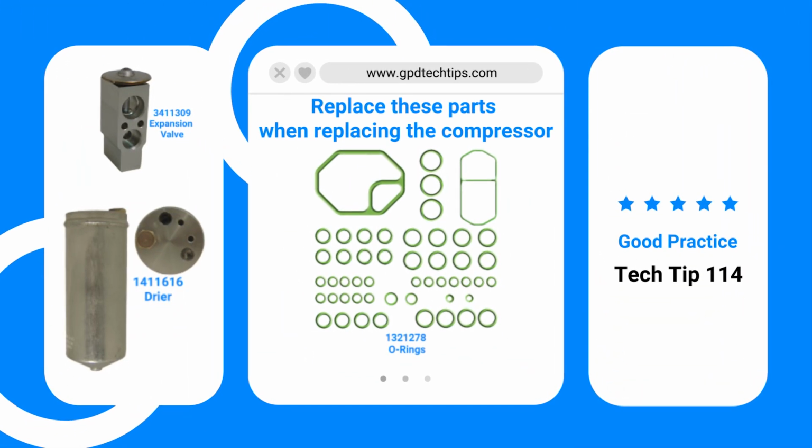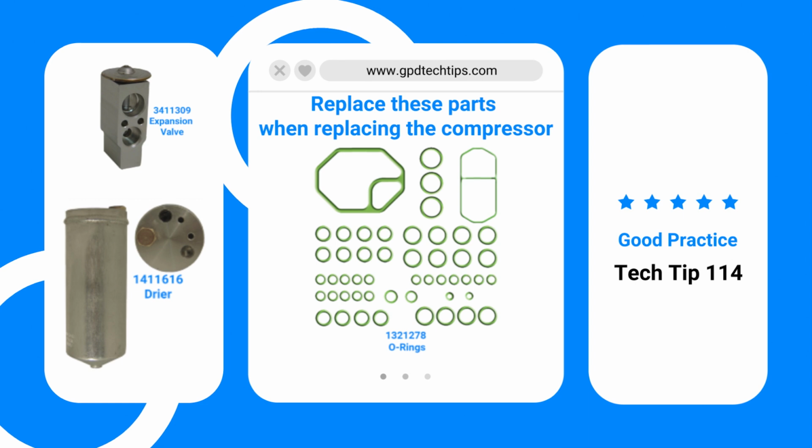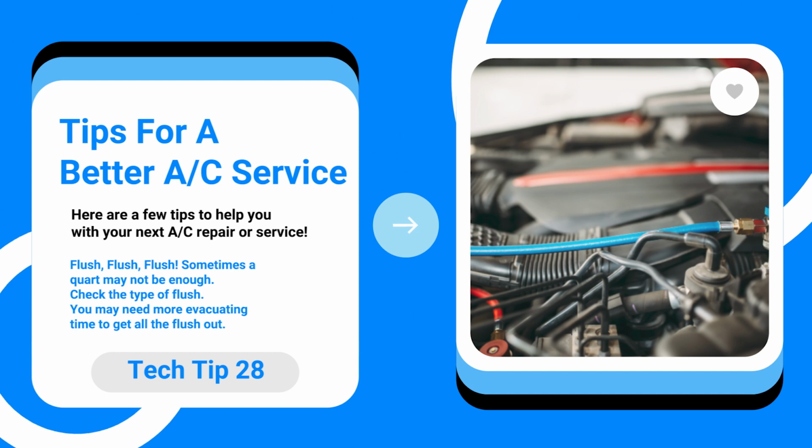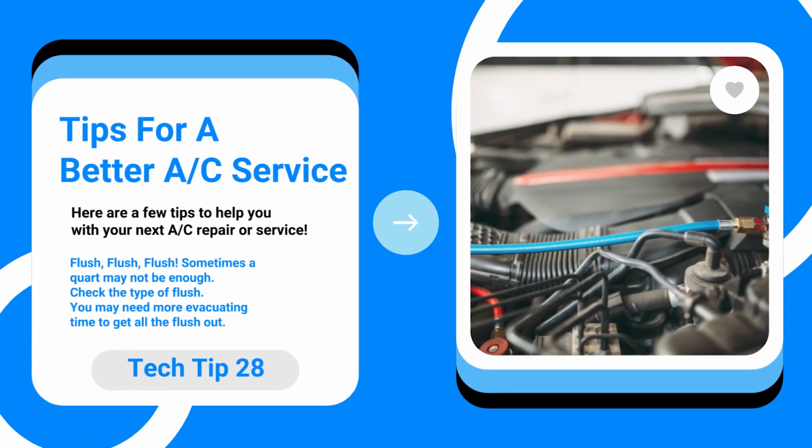When replacing a compressor, it's good practice to replace the dryer, expansion valve, and O-rings. See GPD Tech Tip number 28, Tips for Better AC Service, for more information.